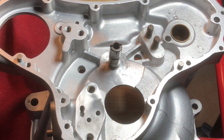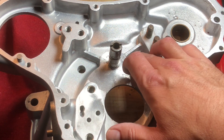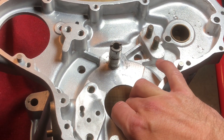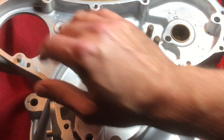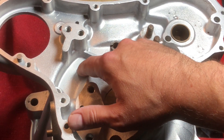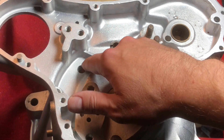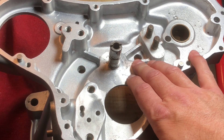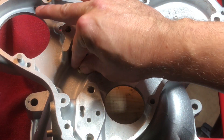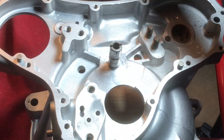This set of crankcase halves were modified using the old Britz method. In that case, the recommendation from that site was to drill additional holes into the timing case from the interior of the crankcase to allow the pressure to breathe through the cover on the side. My preference would be to re-plug these holes back up if I use these cases, because I don't want any pressure from the crankcase itself into the timing case. Amazingly, the plugs that I did find will fit perfectly in these two holes, so I'll have a use for those plugs after all.